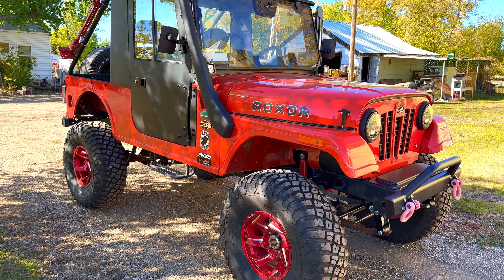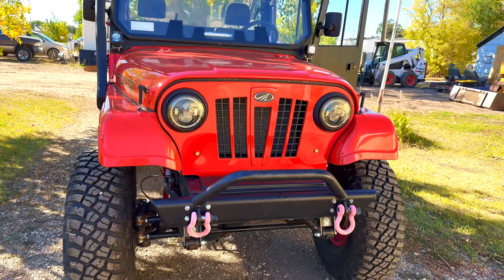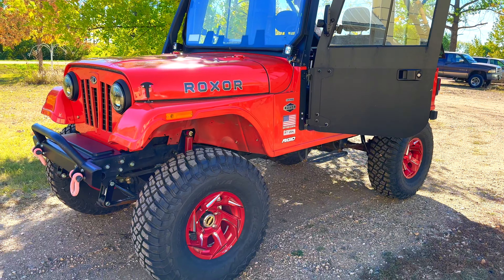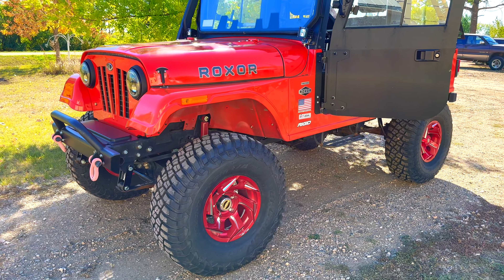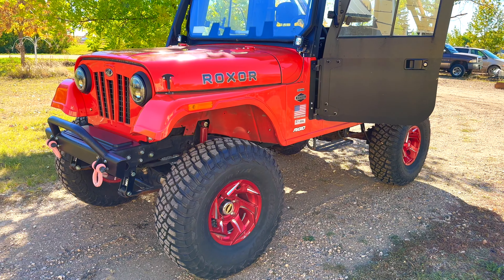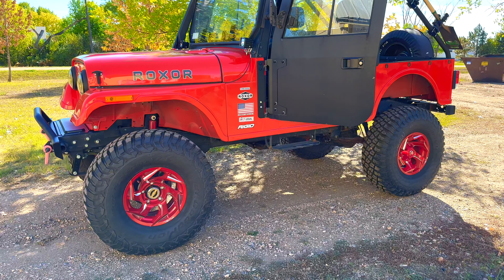I just finished doing the transfer case. Unfortunately I didn't have the right fitting to tighten the drain plug, so it was seeping a little bit — that'll be for another day. The transfer case was also low; it took about half a quart to fill. Do check your differentials and transfer case. I haven't checked the transmission yet, but the low oil in the transfer case might be attributed to some weeping at the bottom plug. It doesn't have that many miles on it, but it's mostly parked.